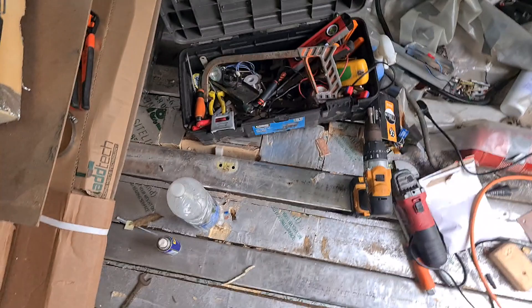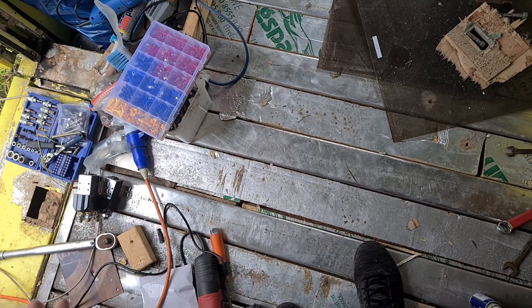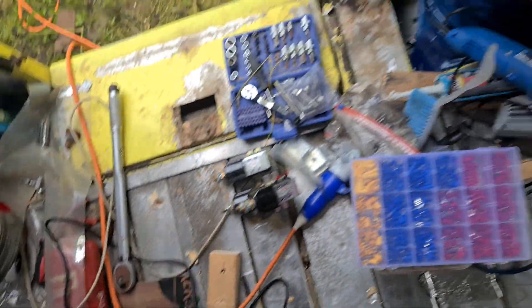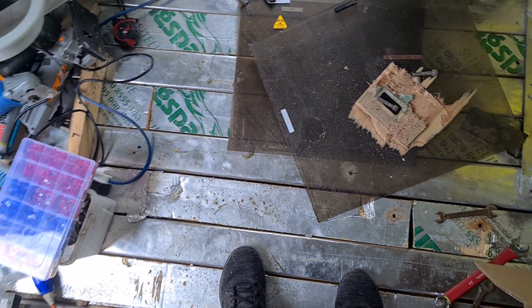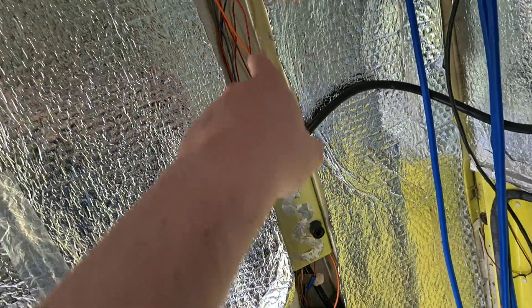So yeah, this is the state of it now. In the ambulance converter group on Facebook there are quite a lot of questions about how well insulated these ambulances are. Well, just this section here is the original floor and it isn't actually half bad. You can see on the steps where dust or something has come in, and little areas where water has got in. In terms of insulation these boxes don't seem too bad, though there are areas where it's missing — just the downside of wiring there, there was never any insulation in there. And in this bit, which was the comms cabinet, as you can see, absolutely no insulation whatsoever.